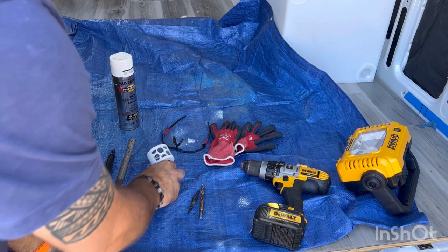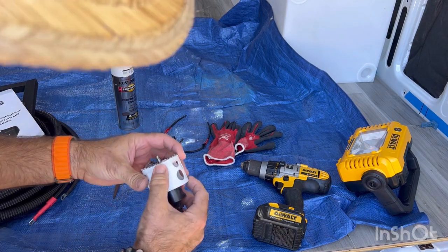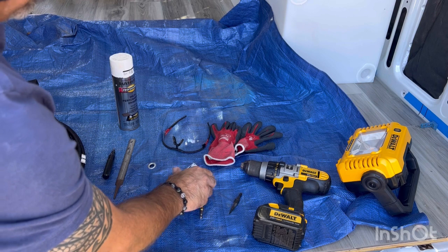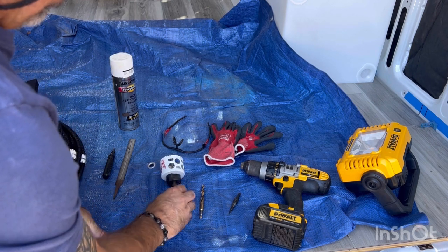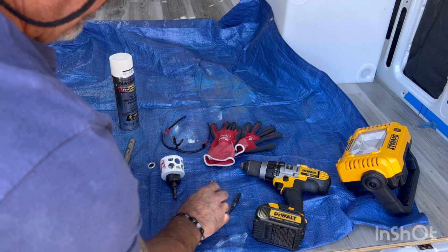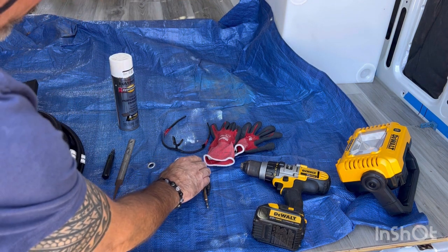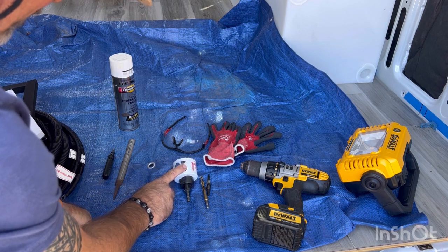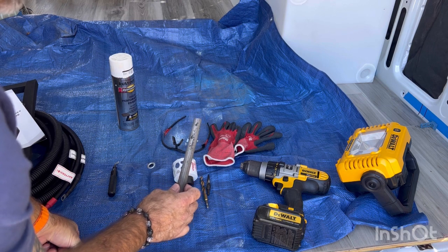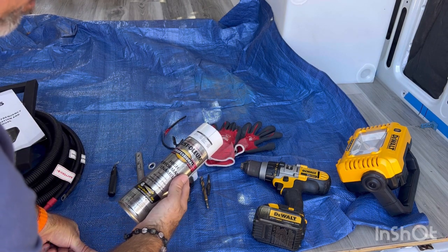Alrighty, tools of the trade. So we're going to use this dozer bit — this happens to fit very nicely for the size of the hole that we're going to drill. This one is the two-and-a-half-inch dozer bit, so we're going to do four holes with that. Then where the studs come out of the air conditioning unit and go through the roof, we're going to use this three-eighths-inch drill bit. And if that's not quite big enough, I'm going to auger it out a little bit. So eight total holes we're doing today. Once the larger holes are done, we're going to take the burrs off with a deburring tool and then smooth things out a bit, and then I'm going to use Rust-Oleum paint so that we don't have any rust as a result.